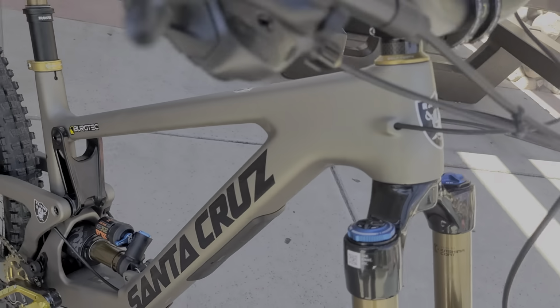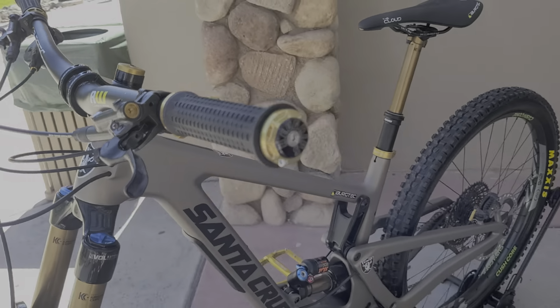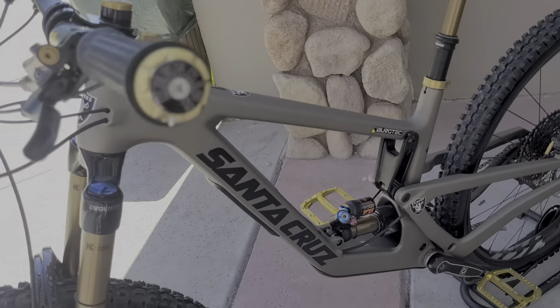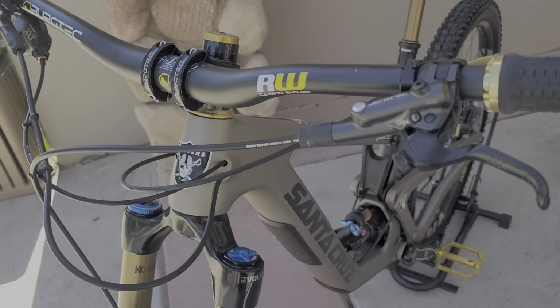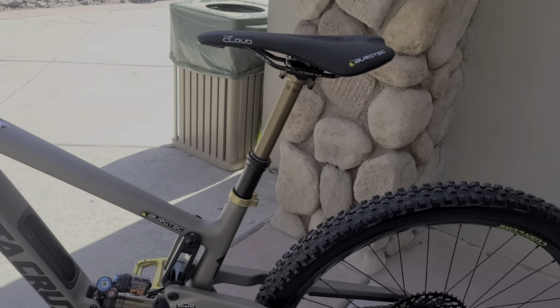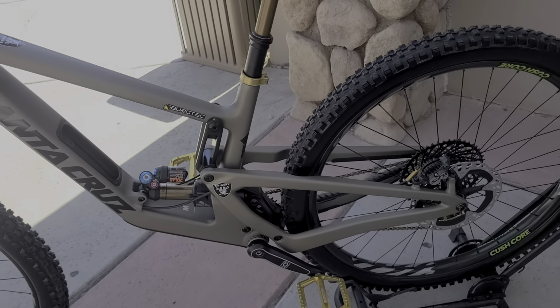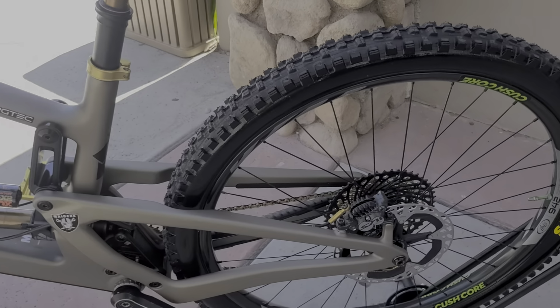I really miss the front derailleur, but it does seem to affect suspension. A front derailleur, the chain even affects suspension. So a lot of guys at park days these days ride chainless, just because the bike is so much more active and you can set it up harder and it just works better with no chain affecting suspension.